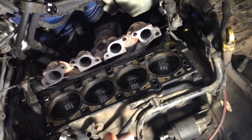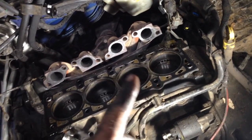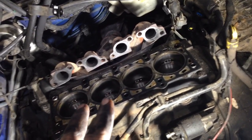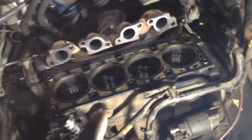In this case we have both. So this cylinder here was just blowing out as fast as I could put air in. These ones here had a tiny bit of compression — they actually probably would have run very, very poorly. These three cylinders may have flashed enough to drive the engine, but it probably would have stalled at idle. So anyway — toast. Let's look at the exhaust.